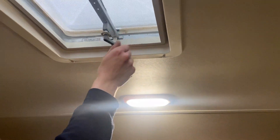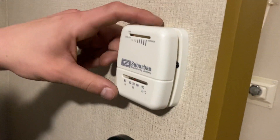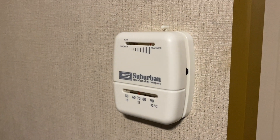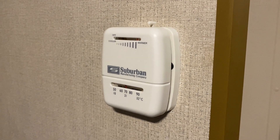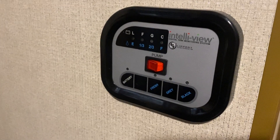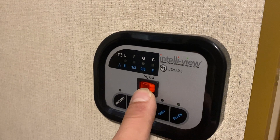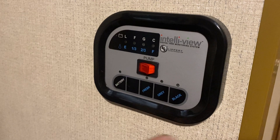Up into the bedroom — your light, again, is just on its own switch. Roof vent here, just turn to open, super simple. Around the corner up on the wall, you've got your thermostat on top. With that slider all the way over to the left, that's it turned off; with it all the way over to the right, that's max heat; anywhere in the middle is your temperature selection. Down below that, we've got your monitor panel. Right front and center is your pump switch — turn that on to turn on your water pump, drawing from your fresh tank to pressurize your lines.